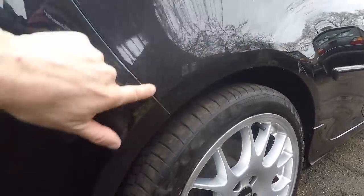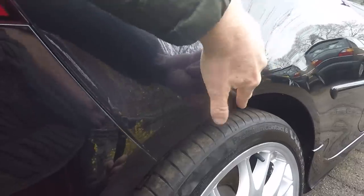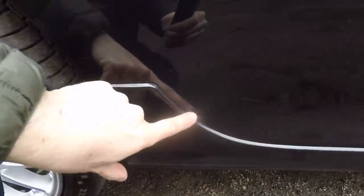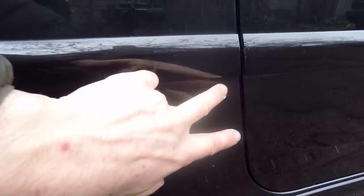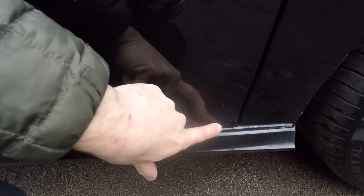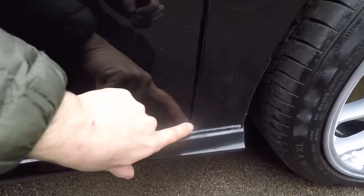It's not unknown to get corrosion of the rear wheel arches if people have fitted big wheels and low suspension that rubs the paintwork. Even if they're not on the car now, it's worth checking for that. As I mentioned in episode one, there's a bit of corrosion down here, which isn't ideal. It's going to be a big job to fix that — it's going to involve painting most of the car, so we'll leave that for a bit. There's a scratch there that'll polish. A few little chips all over the car. The edge of the moulding's damaged a bit. The door edge is okay but it feels a bit rough, so I think it's been touched in. There's a bit of scratching around the door handle there, which is normal. Down here though, there's a bit of corrosion at the front of the door — I don't know how you'd get that, unless it was damaged when the wing was replaced. There's corrosion down here as well on the sill under the wing, which is not unusual on Mark V, so definitely worth checking.